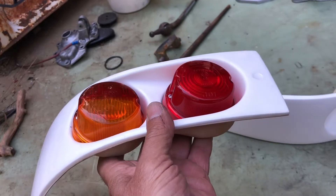Once this is fit, I screw the other one to it and then use a little scroll saw. The other one is the brake light unit — it has a plastic ABS backing. By screwing it to the one I had already made fit, using it as a template, the brake light unit has a drain at the bottom. I sliced into the drain and started my cut, gently sawing around because the way it's made there's a raised edge, and that's exactly what I'm cutting off. You can still see where the sharp edges reshaped my fingertips, but here's the piece cut off — just that rim — now shaped exactly like the first one.